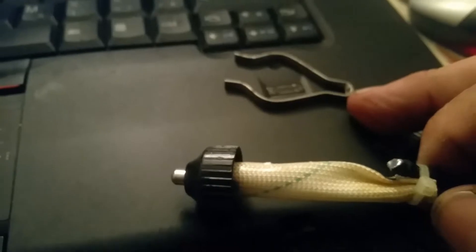Our test results show that there's no continuity between these sidearms and the appropriate wire coming down here by my finger. So what we're going to do is open this up. We're going to check the fuse inside and check the wire connections inside to see if possibly one of the wires inside is pulled loose. When I took it apart, I unscrewed the cap here — you see where the cap unscrews — then you grab the wire from the base and push it up through the housing, and it causes the entire center mechanism to be pushed outward. We can see that this wire frame, which is actually your side pickups for your power point, at one point was soldered to this terminal here. So we have a broken circuit.